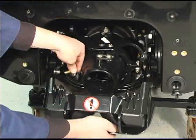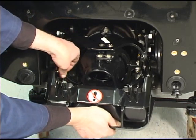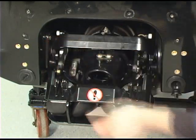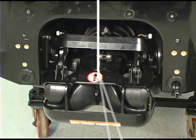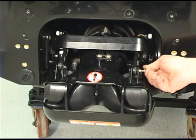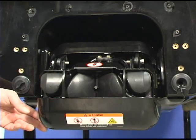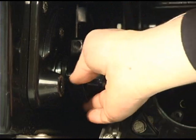Install the IBR gate. Lower the U-arm over the jet pump. Connect the IBR gate at the linkage arms to the U-arm. Using your hand, move the IBR gate to the up position. Install the IBR key.